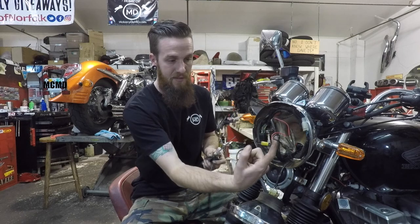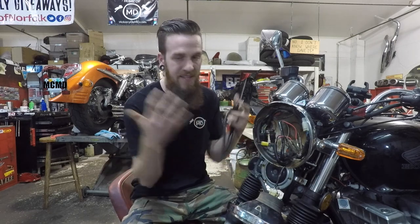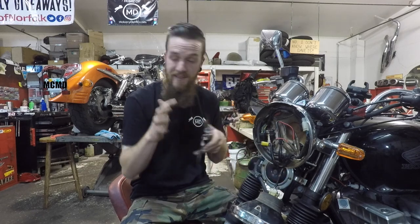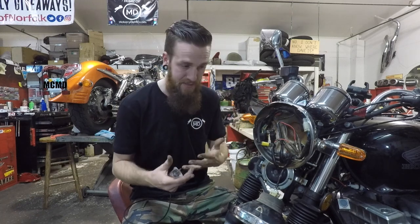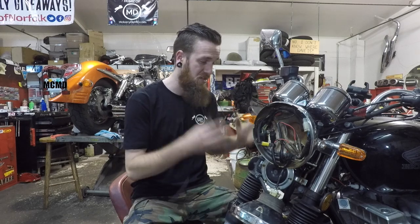When it comes to any electrical diagnostic procedure, you've got to have some information about your bike. You can go on Facebook groups or forums and post pictures, but that's just having someone else answer the question — it's not teaching you anything. What you need is a wiring schematic. I know they may look intimidating, and I'm going to walk you through a quick step on how to use them. Remember, we are working with electricity, so take all safety precautions.